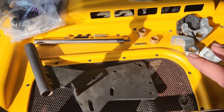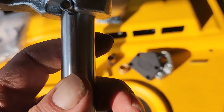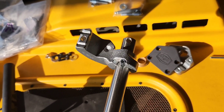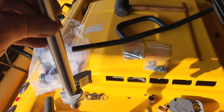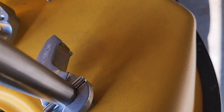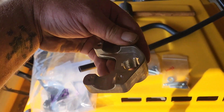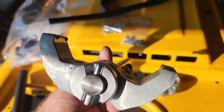I'm going to go ahead and pre-assemble this. So I've got the first little leg on, which required me to put in one of those roll pins in the first hole. Then there's a snap ring that holds this first one on, and you can see how it's able to move. It's going to be facing the front, like so. What you have to be mindful of when you put that snap ring in there - with this leg facing forward - there's a keyway there. That keyway has to match up with how your handlebars are going to sit, which is going to be towards the back. Got both of those in. Put that roll pin in. Pretty simple.